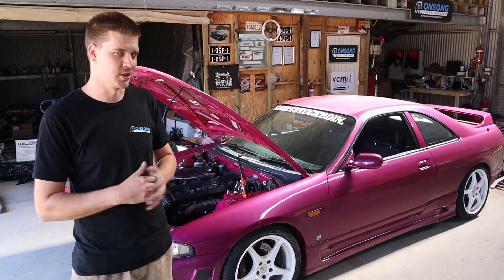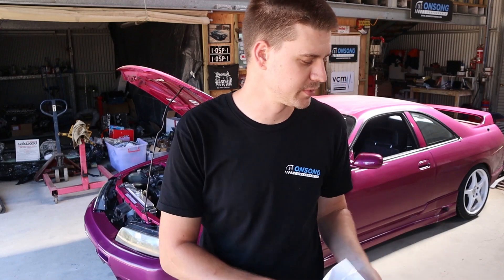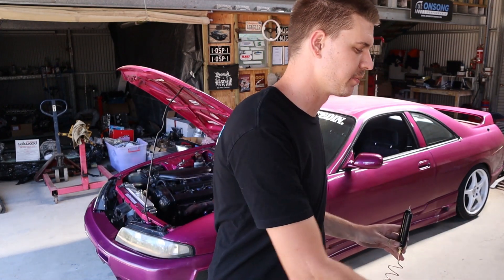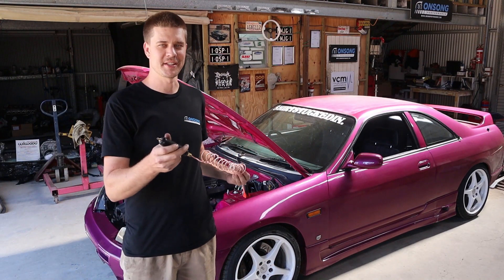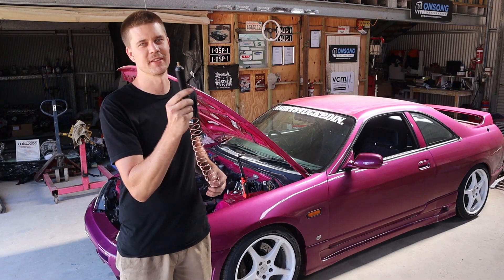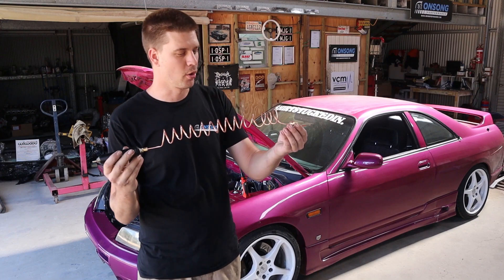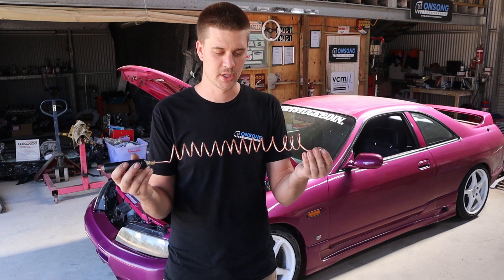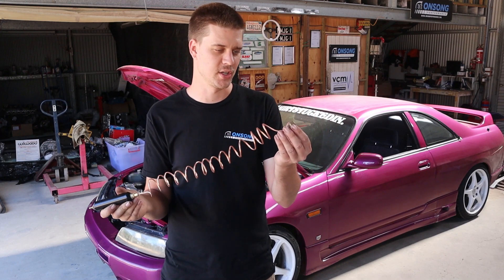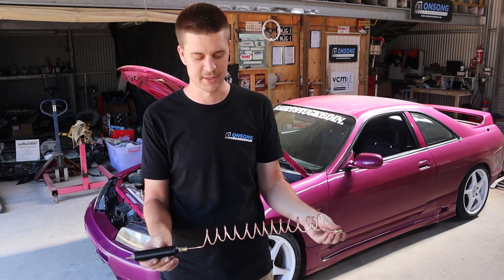We'll look at changing over to the new ECU. I went and got the gaskets needed to get this thing back together today, which is awesome. I've got my new gaskets and the last thing I needed to complete my exhaust MAP — a little filter canister. I also bought an oil gauge kit you can buy from most auto shops: a long bit of copper tube with fittings at each end, olive-crushed fittings that go to 1/8 NPT.